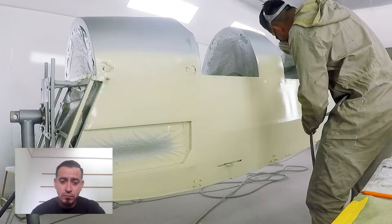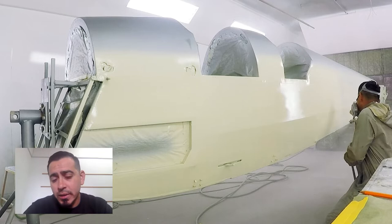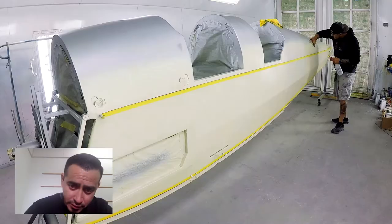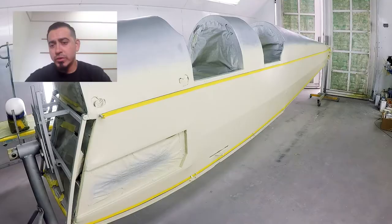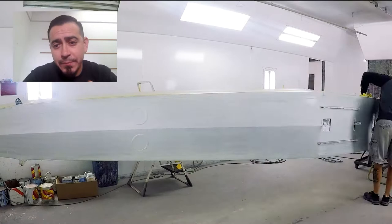On the video you can see I've already got my first coat of cream on. I'm only doing a section because that's the only area where the cream is going to be — it's not necessary to spray the entire fuselage with the cream. Here's the second coat: the first coat is always a light coat followed by two wet coats. Once you shoot the cream, let it sit — before masking onto fresh paint I recommend letting it sit for at least 48 hours.